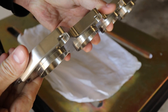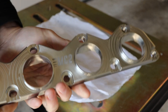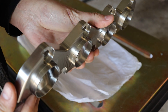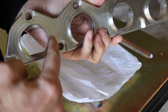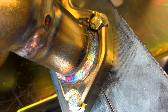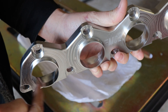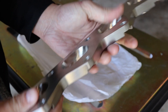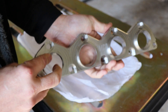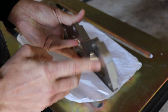So here is the redesigned flange. I think you can kind of see what I'm doing here. Rather than the pipe sitting down into the flange and having to weld onto the flange itself, I thought it would be a great idea to have a little bit of a leg that comes out, so you're only welding on that part and not heating up the flange — keeping it from warping, which the one on the car did a little bit; this ear warped up just a touch.